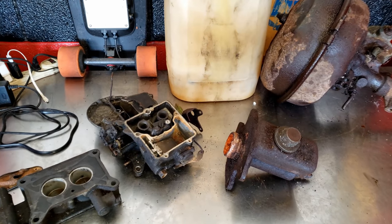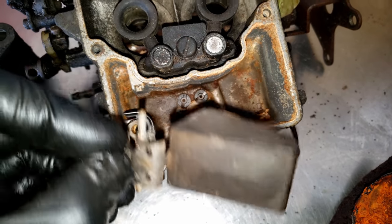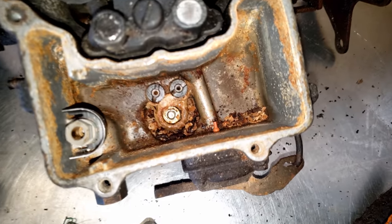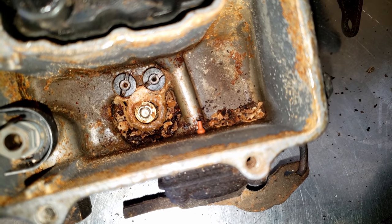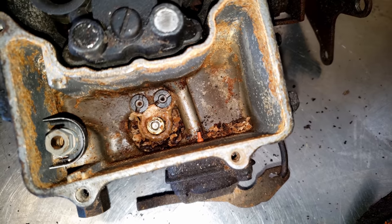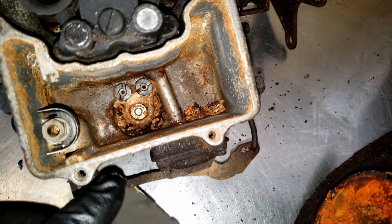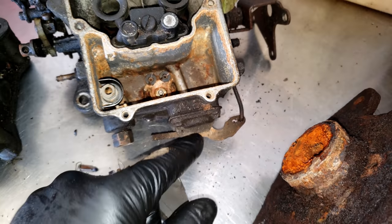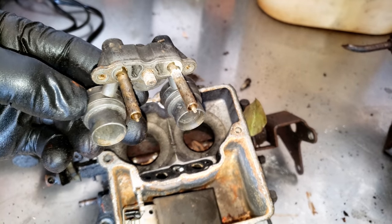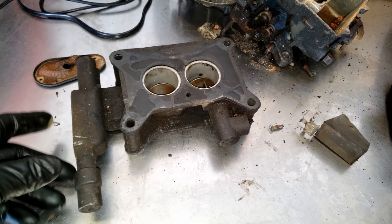Just over at my workbench — wanted to touch on these parts. Popped the carburetor apart: the float was in good shape and working, needle and seat in nice shape too, no corrosion. However just a bunch of rust and crud in there which clogged the main jets solid. The pumper diaphragm is completely torn too, so it was pissing out of the pumper. The atomizers or emulsion tubes are all blocked up too. This thing definitely needs a thorough cleaning.